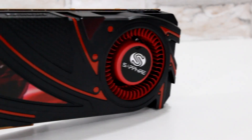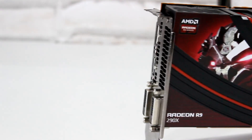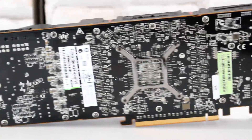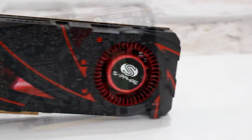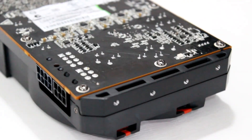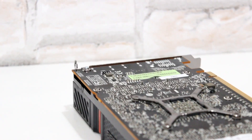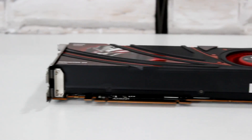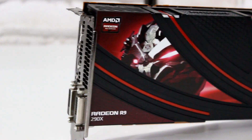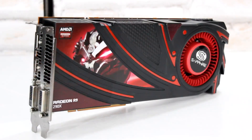The difference between quiet and Uber mode is minimal though. What I noticed in most cases when in Uber mode, you get higher minimum frame rates. This can indeed be helpful, but not really at 1080p, because the power consumption difference between quiet and Uber mode is pretty big — 58 watts in my case. That's not worth the extra minimum FPS when it comes to 1080p gaming. The power consumption overall is lower than the GTX 780, but not by much. The temperatures both in quiet and Uber mode are 95 degrees Celsius on full load. When gaming, I easily reached 89 to 92 degrees Celsius. I didn't experience any throttling and therefore the performance was stable. The R9 290X definitely is a loud card, but I expected it worse to be honest. It is louder than most other cards, but not really that annoying.